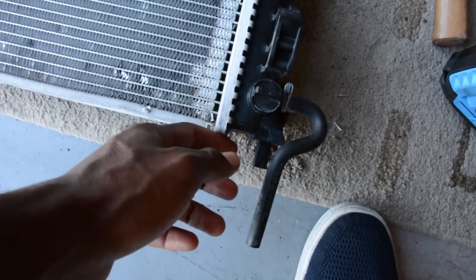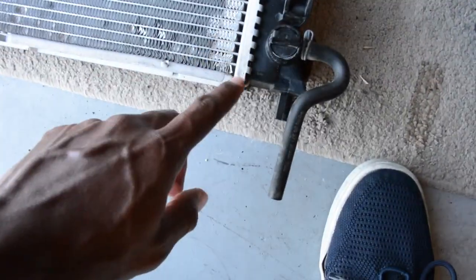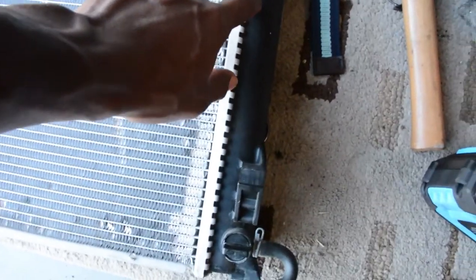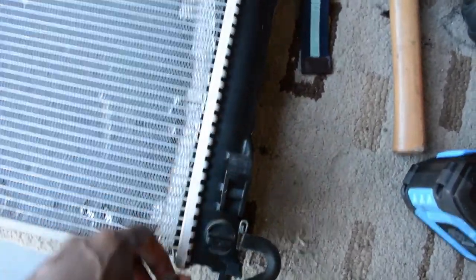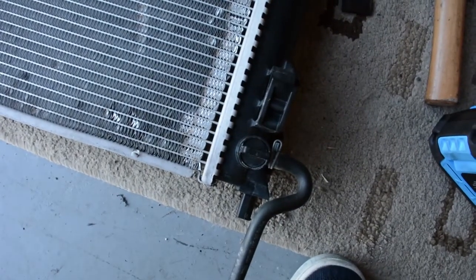The radiator is leaking. This radiator has a support bracket that goes underneath it — a big long rod that's underneath the car right now under the new radiator. When I pulled the support bracket down, I noticed the radiator fluid all the way at this seal on this plastic piece right here, so it's actually leaking out in between where this plastic piece is sealed to the actual aluminum fins of the radiator. No bueno. I had to source a brand new radiator — shout out to Mopar Giants, which is where I got it from. It was an exact Mopar replacement Hellcat radiator with all the clips, and I just reused the hoses from the car since they looked great and weren't cracked.